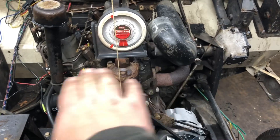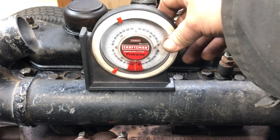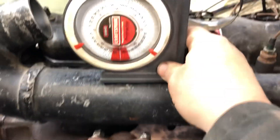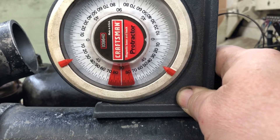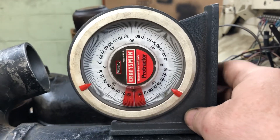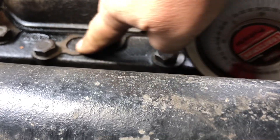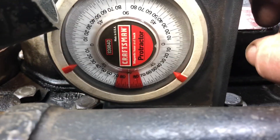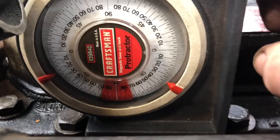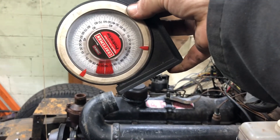So the engine is sitting horizontal — zero degrees this way. If we come over here to the intake manifold, we're sitting at just about one degree, maybe even half a degree past zero. Going this way is about half a degree. Then down here where there's a flat spot on the block, we're again just about one degree tilted. So the engine is tilted maybe about one degree this way.